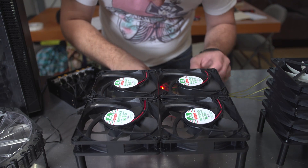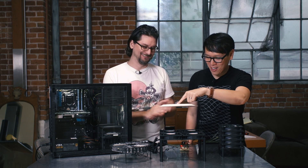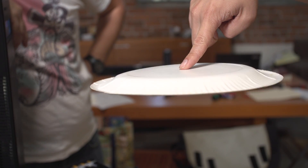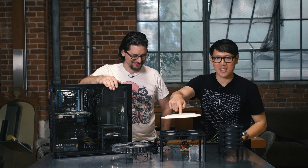And finally, a matrix of fans — two by two. That's a lot of air movement. We went a little old school here; these are not your typical case fans. These are 3,300 RPM — you can hear them — but they're moving a lot of air. So there you have it: negative air pressure is a little more effective than positive air pressure, and an array of fans is more effective than one big fan or definitely a stack of fans. No stack of fans. We'll see you guys next time.